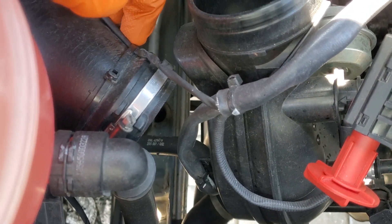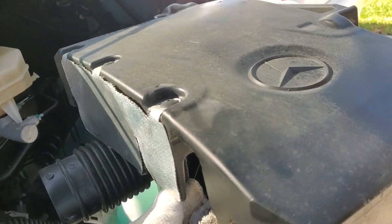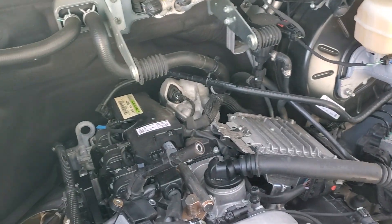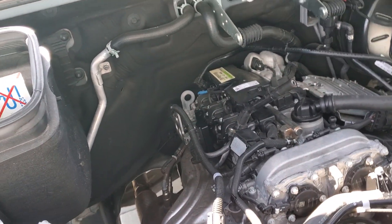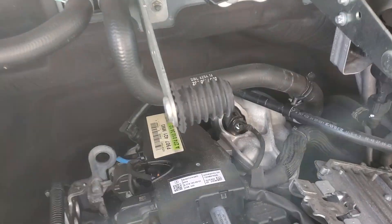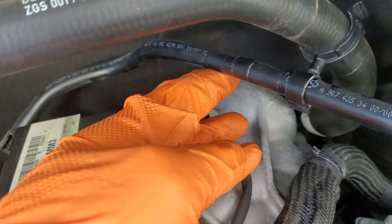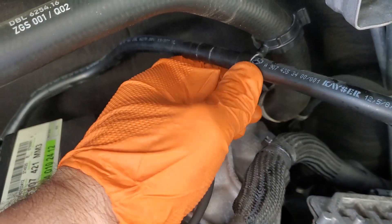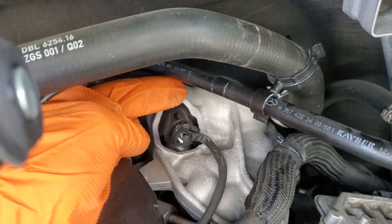There's not a lot of stress on this wire — you could just cut that zip tie and release some stress. Then you've got this cover, the rubber sound cover. This thing is on there pretty nicely but it's actually very friendly. The toughest part: I recommend starting at the farthest point. I have a little baby footstool here which helps. Start in the farthest corner — the rubber cover is pinched underneath this hose. Slide the hose out of the way and leverage up that far corner, then slide her out.